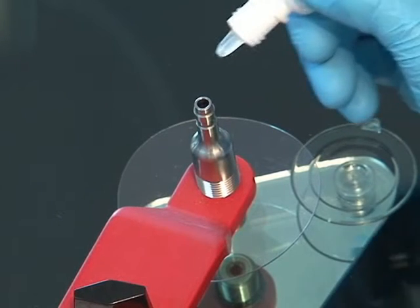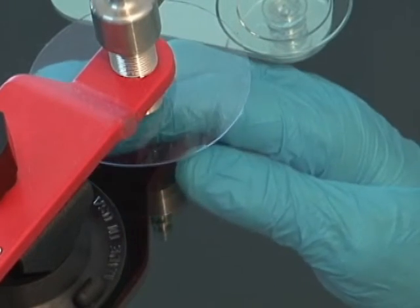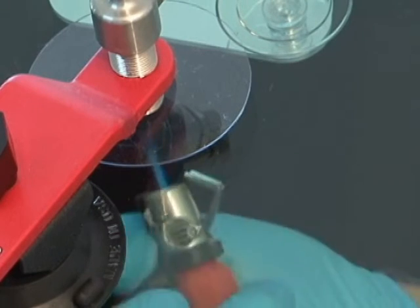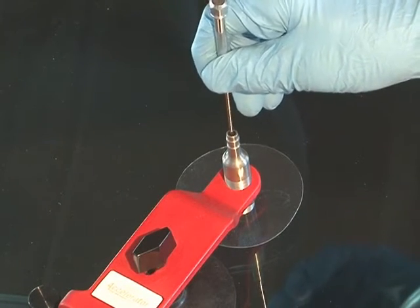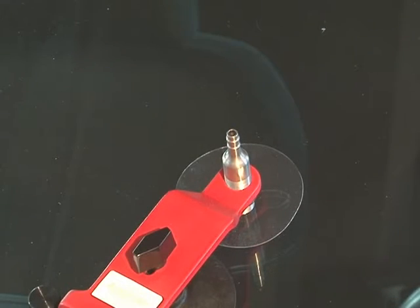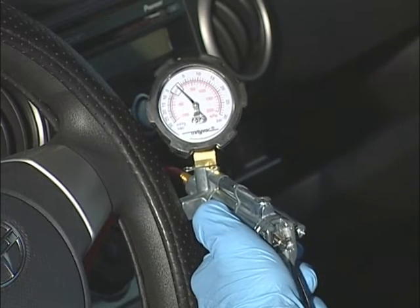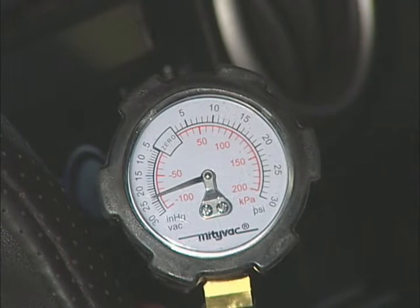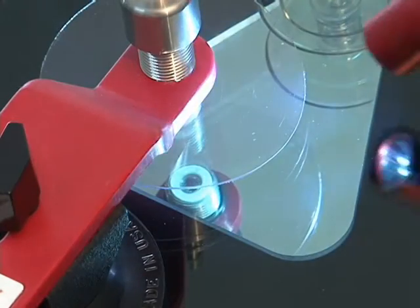Choose the appropriate resin and place a few drops — three to five — into the injector tube. If the windshield is cold, heat the area with the torch or heat gun. Caution: do not overheat, as this may cause flowering of the resin between the PVB and the glass. Place the probe into the injector and apply slight pressure on the pit to begin the wicking action process. Remove the probe and attach the hose on top of the injector. Take the vacuum pump and move to the inside of the vehicle. Rotate the switch on the pump to vacuum and apply vacuum to remove air from the break. Pump until you have between 15 to 25 inches HG. Allow the vacuum process to continue until bubbles are no longer rising to the top of the pit — usually 30 seconds to 2 minutes. Use the LED light to observe this process.